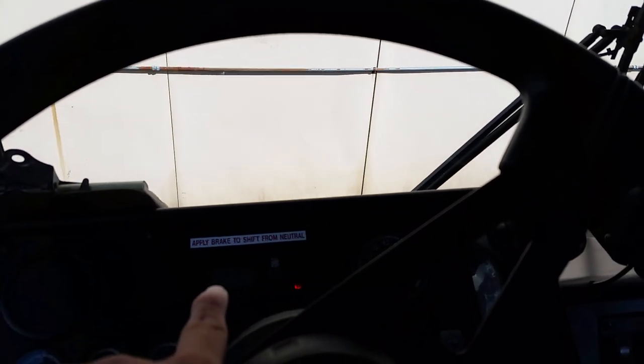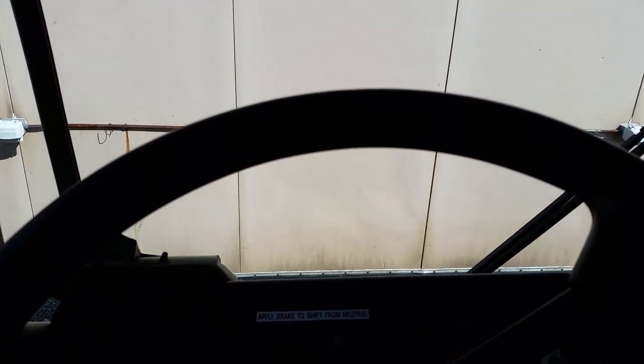What should happen is from 65 to 60 PSI the audible alarm should come on and the wigwag will fall and start wagging. I have had a few drivers that have blown an airbag or blown a line to the air seat or something like that, and the pressure doesn't fall right away, but the wigwag will come down to let you know there's a pretty big air leak.